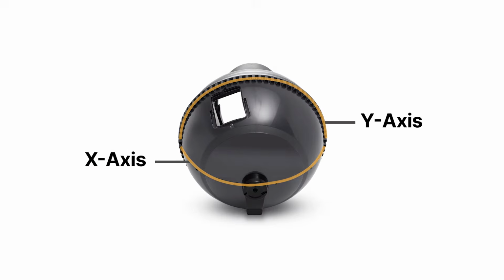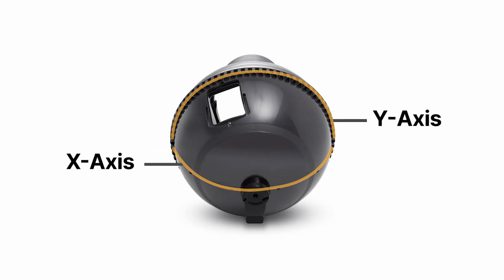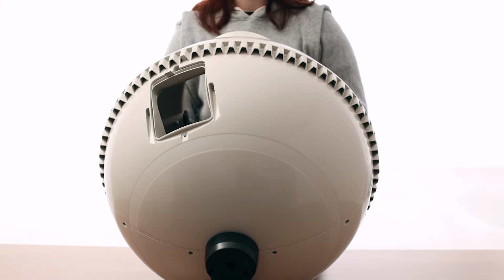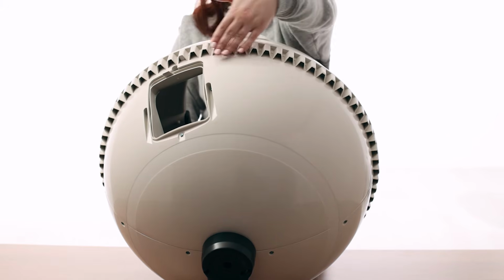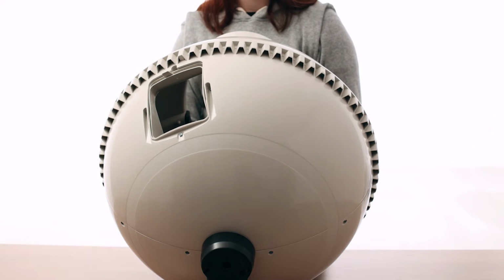If you've previously disassembled your globe at its Y-axis to inspect the magnets, it's possible that it was reassembled incorrectly. The robot uses 2 magnets, located in the globe gear track to monitor the position of the globe. The magnets could be missing or put in backwards, reversing the required polarity. If you have recently disassembled your globe, use these troubleshooting steps.